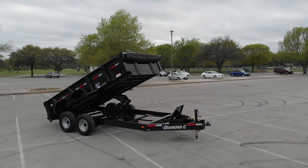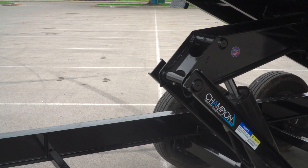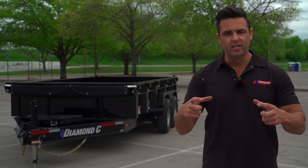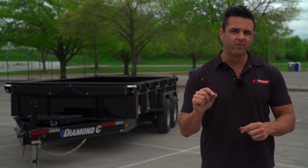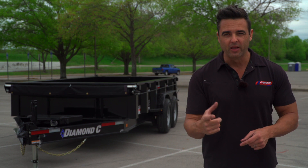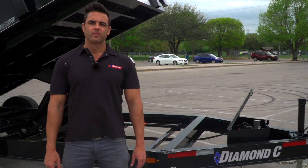The difference in the scissor lift that Diamond C features — as standard — is a six-inch bore cylinder. Most other companies use a five-inch bore cylinder. The cylinder itself is an inch wider. In and of itself that's not a big deal, since scissor lifts on the market are all rated for the 14,000-pound capacity they state. But if it's the same money — or even less money — to go to a six-inch bore cylinder versus a five-inch bore cylinder, why wouldn't you? I'd go to the six.